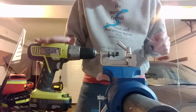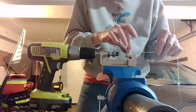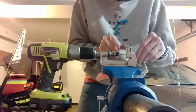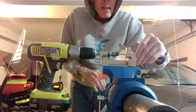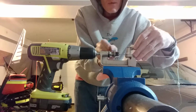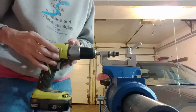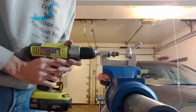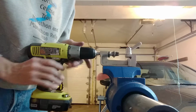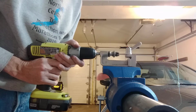I like to hook up my electric drill so that I don't have to use the little handle. I find if I use the handle I wiggle so much that I don't cut or roll good threads. So then all I do is set this so that the edge is right where the rollers start. You want a little bit of wiggle room so that the rollers aren't engaged immediately. Then make sure I'm rolling forward, fairly slowly. The Hozan manual says you want 9 parts force that way to 1 part force turning. No way for me to gauge that with this, but what it means is I hold this and give a decent lean while spinning, fairly slowly, medium speed.